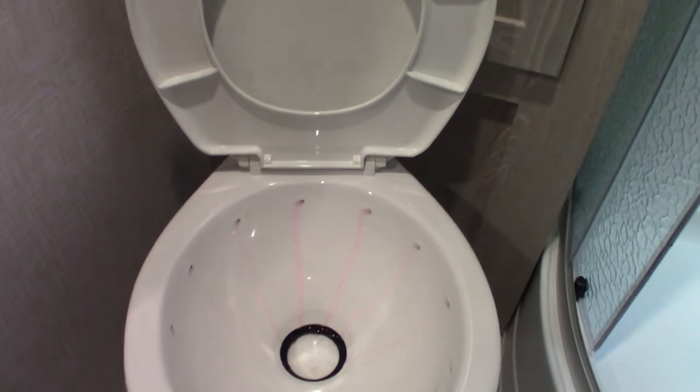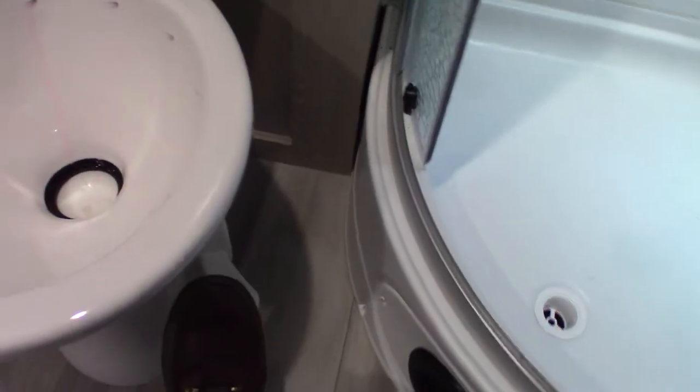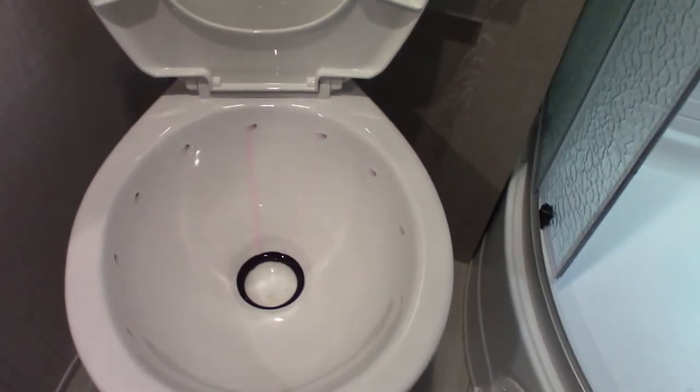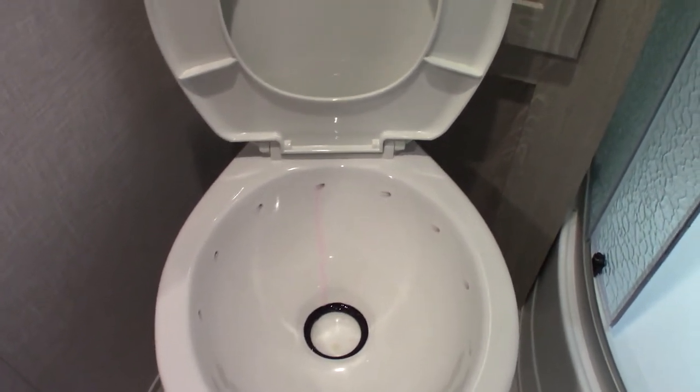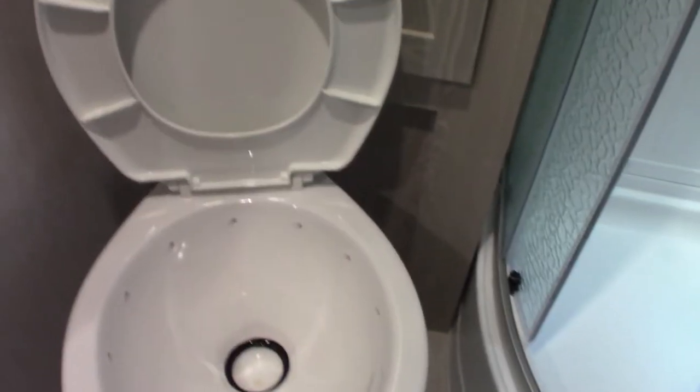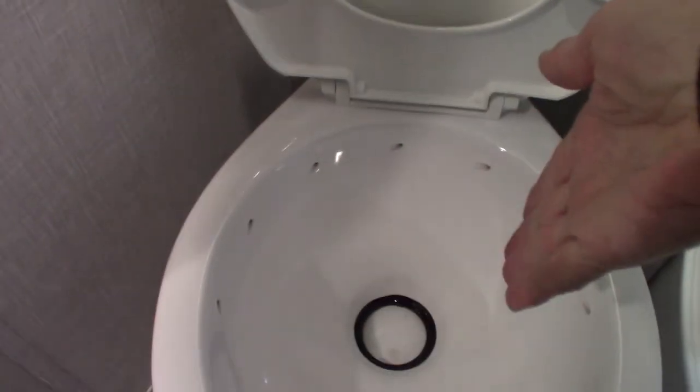The toilet must have chemical and water in it — the black tank is directly below. This is a little antifreeze from the winterization. When you hook up your power and water at the campsite, come in here and dump a dose of chemical right into the bowl, then step on the pedal so water comes swirling in — hold it long enough to put about a gallon of water in there. You must have water and chemical in the black tank before you start using it; otherwise the smell will be terrible and it can get clogged. After dumping, repeat the procedure — a dose of chemical and a gallon of water — and you're set until the next dump.